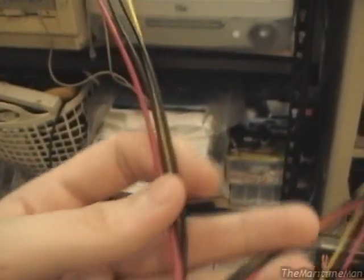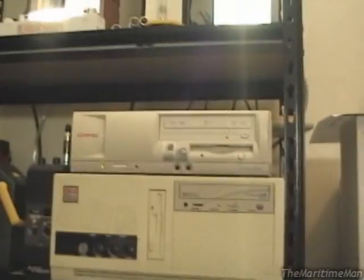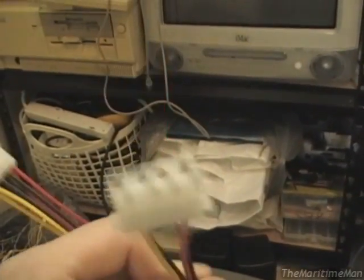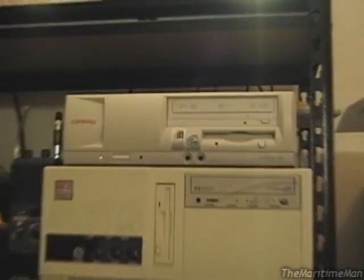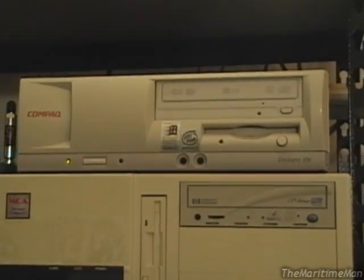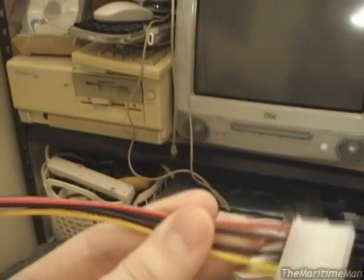So what I'm going to do is take wire cutters and cut a couple of these off right here, so it leaves the head with that much wire, and solder these in place of the Molex connectors on the power supply in the computer. Basically I'll be putting new Molex connectors on it, so hopefully I won't break anything. It's a very simple procedure in theory — I should have no problem doing that, even though I have horrible soldering skills.